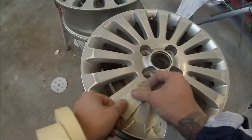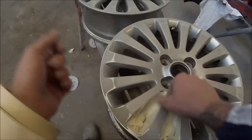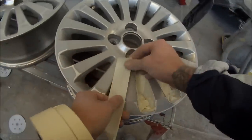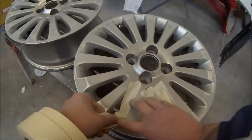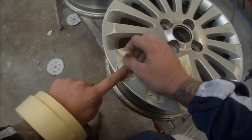I've just decided to do a hard edge across here. You could ultimately do a false edge over there, but I've found for wheels you don't want to go overloading the product on — two coats is not going to be too big of an edge there to rub back with the primer.